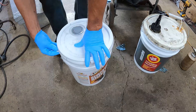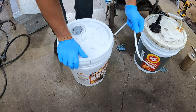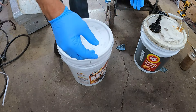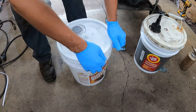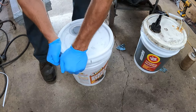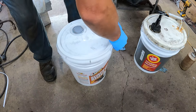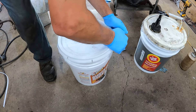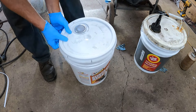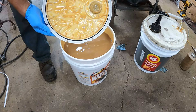It's not going to hurt anything. Some rubber components will swell up, like door seals and stuff - if you spray some rubber door seals they tend to expand and get a little bit loose. You can spray it on electrical components, anything besides the exhaust system, the engine, and the brakes. It won't hurt paint, it won't hurt wiring, it won't hurt plastic - just like rubber, sometimes it makes it expand.